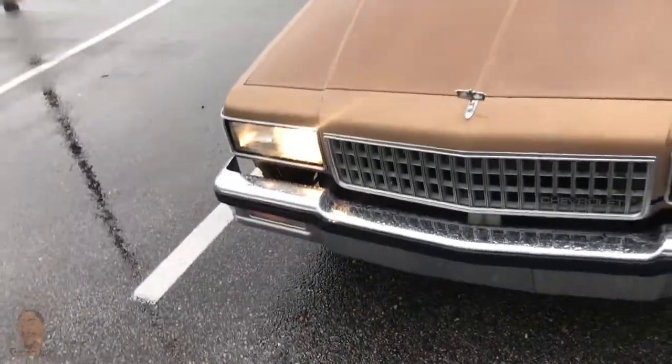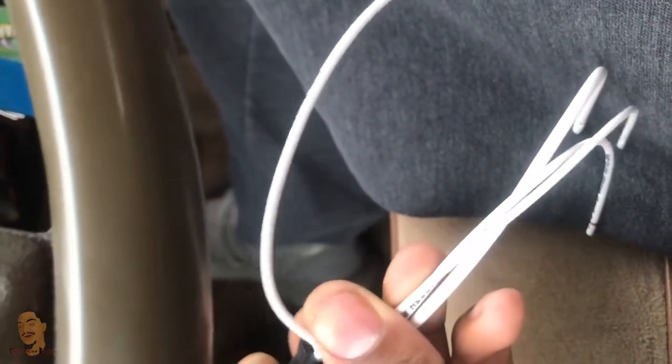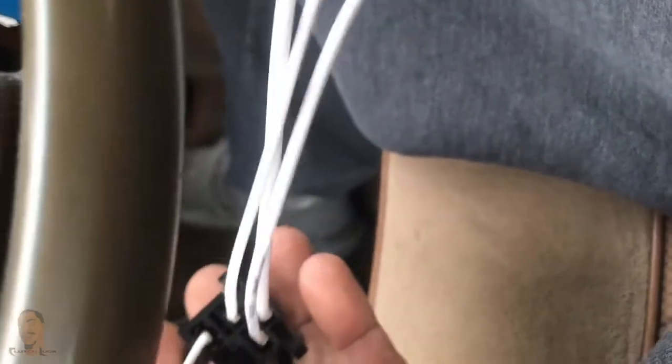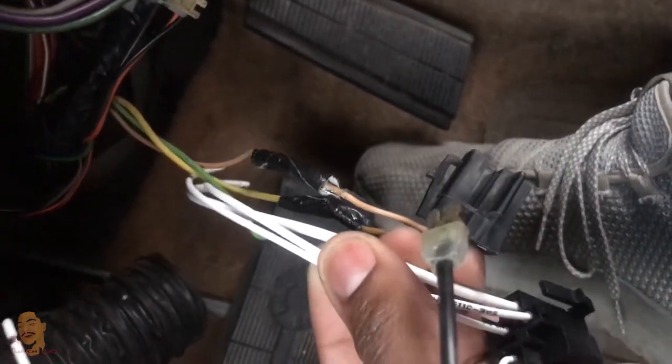Now I think my issue is with the harness. I got four connectors — this top one I don't need. I don't know what that's for — maybe another Caprice has an extra fog light or something. But I don't need this one, I just need these three right here. So there's a green one, a yellow one, and a brown one. We don't have to make this complicated — just line them up and replace them accordingly. So all I'm gonna do is solder these three wires on and then connect it back to the dimmer switch. And it's that simple.